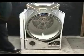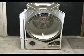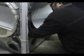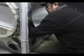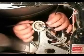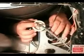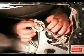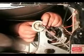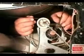Make sure the belt is in place. Get in front of the dryer and insert your hands under the drum. Use long sleeve jacket or shirt so you don't scratch yourself. Place the belt with the ridges pointing up on top of the idle pulley wheel and under the motor pulley. Release the idle pulley from the hook by pushing it with your thumb. Remember that you're going to do this by feeling and not by seeing.